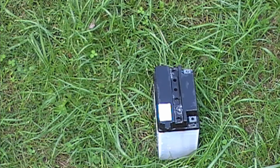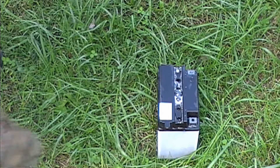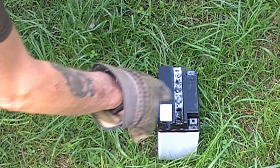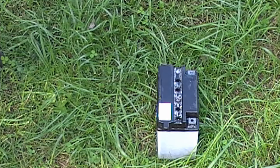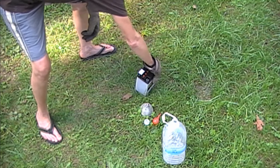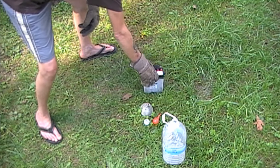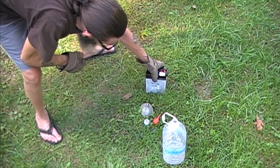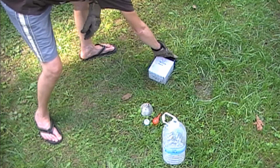Check that out folks — bubbling city! I poured it out once, bubbling city. You know, it doesn't hurt to be kind of rough with the battery. Shake it around good. You can even put the caps back in it and roll it around on the ground to really make it get active. You can hear it bubbling; see it coming out of the overflow. Don't worry about being too rough — jolt it around good to break those crystals loose from the plates and get them out.